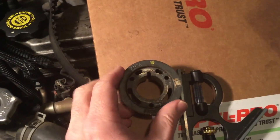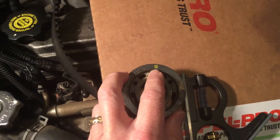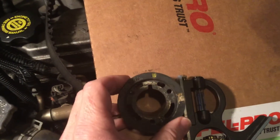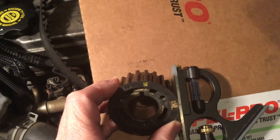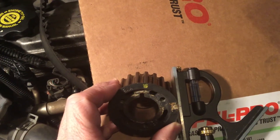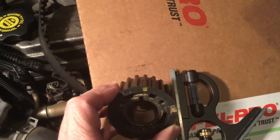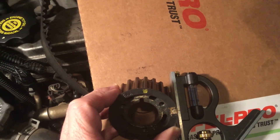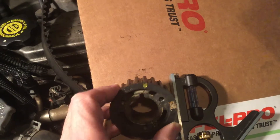From the factory you can see the little yellow arrow was marked — somebody in the factory did it. You'll take a look and see how it lines up with the left edge of that timing gear sprocket. If you follow that line straight back, you'll see the lineup mark on the rear timing belt cover.